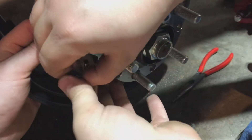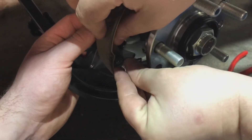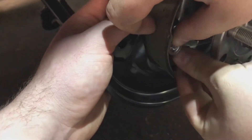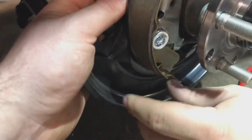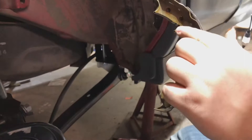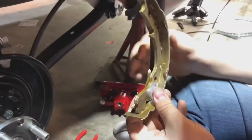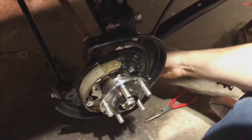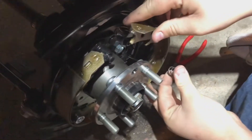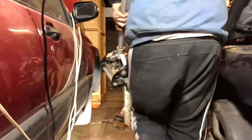They make a tool for this but we don't own it since we don't work on drum brakes half the time. It's going to be difficult to see, but I'm going to get in here, push it down, and twist the end piece — now that end piece is compressing on that spring, and when Nick lets off, the parking brake shoe stays there. We grab our other shoe — it's got the same deal, some chamfers, some other cutouts, and another hole that our other rod goes through.